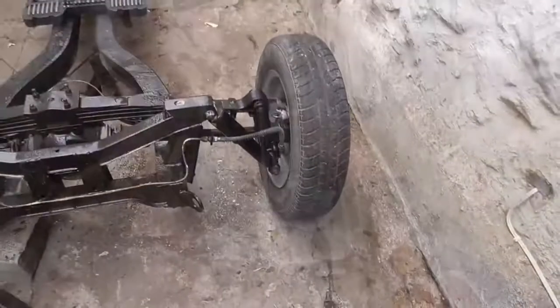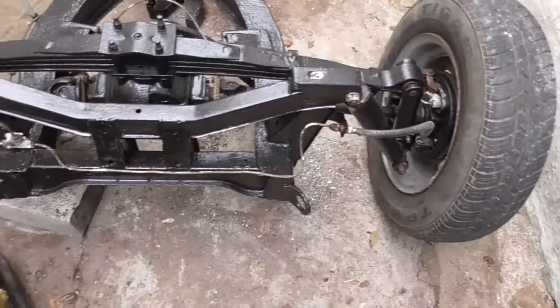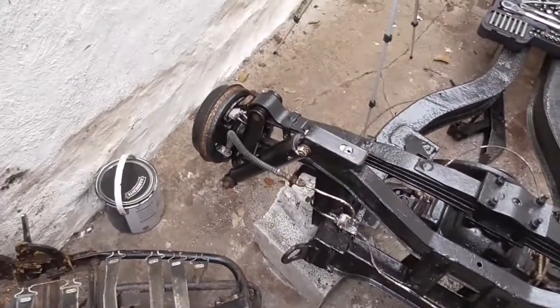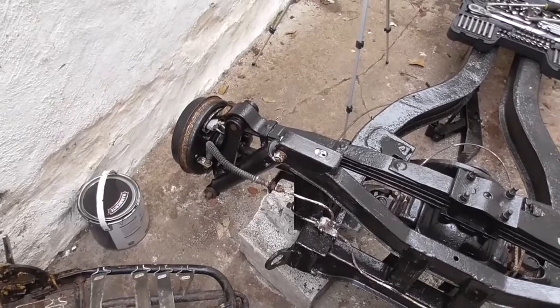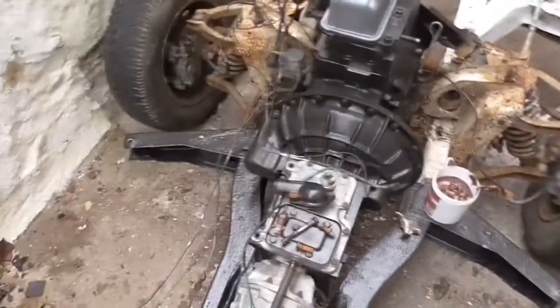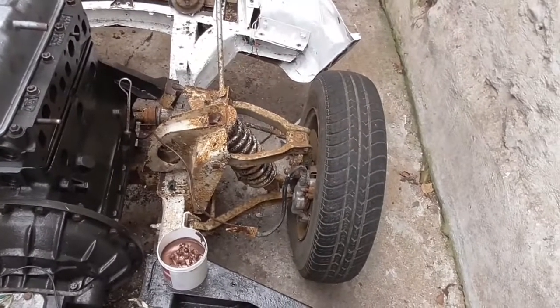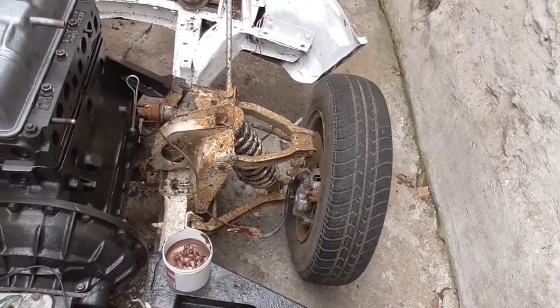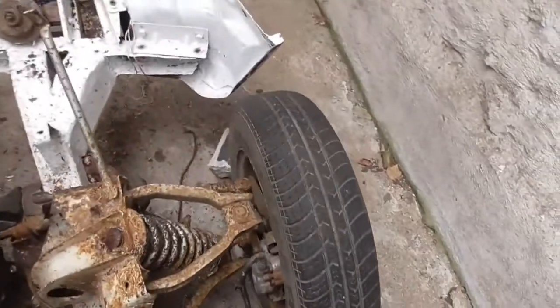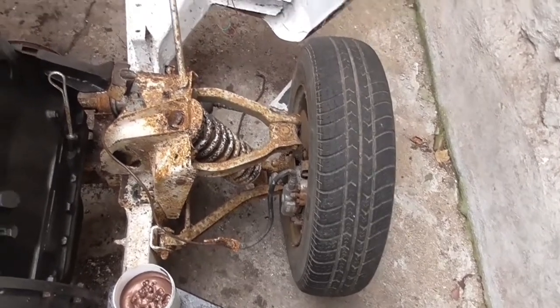So that's the back end of the frame all painted up now. I'm just going to give the brake lines a clean just to make them look nicer. I've got a wheel to repaint today on that side. Brakes are all done on that side, that's all working. The chassis is now all painted up through underneath my tool kit and all the way up to the front outriggers. Next job will be getting the front end off and checking the components, especially the bushes, any ball joints, mounting roll bar arms, track rod ends, and obviously check the brakes.